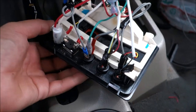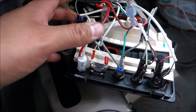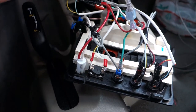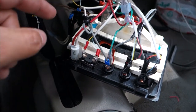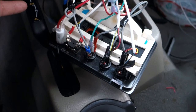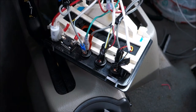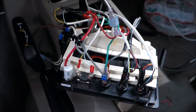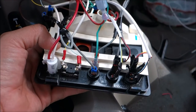I'm in the cab — all the switches are wired up and ready to go. I just need to clean up this bird's nest and zip-tie and tape all the wires to make it neat. Make sure you test everything before buttoning it up. I'm going to pop the fuse back in and test each switch. It's really important to have a fuse in your line — without one you might cause a short and potentially a fire. I have mine in the engine bay for quick access, so if I pop a fuse I can replace it quickly.